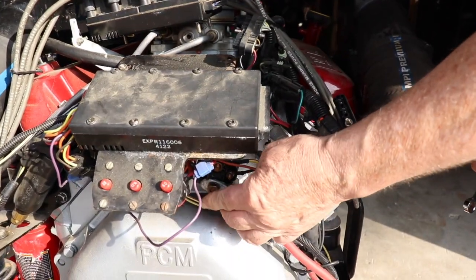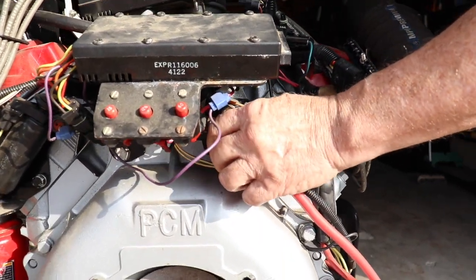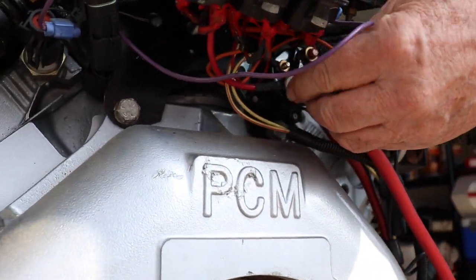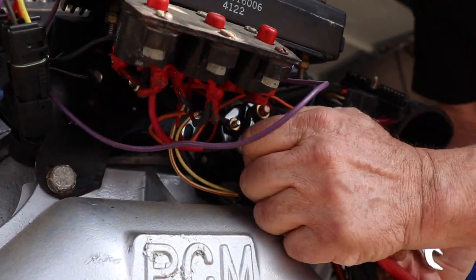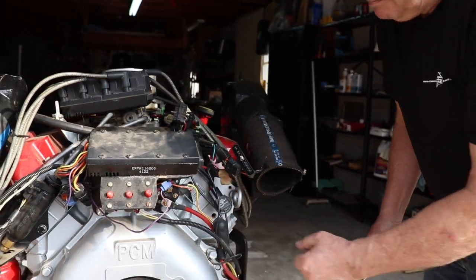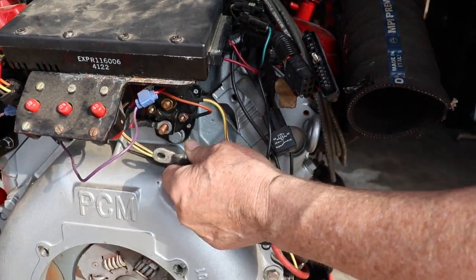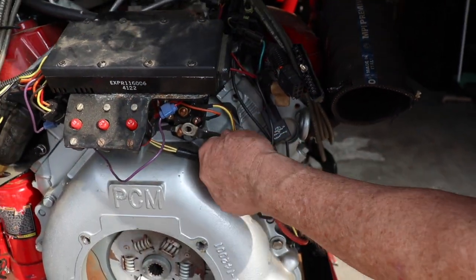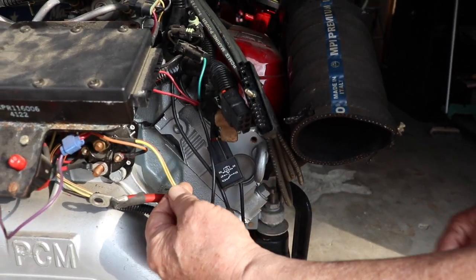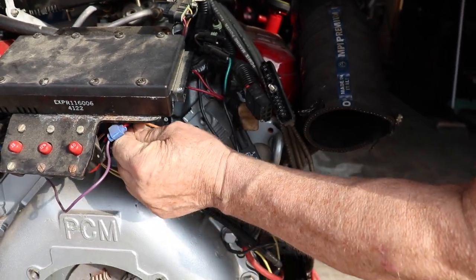This particular engine is a Pro-Tech engine, but this panel will be on a carbureted engine as well as a fuel-injected engine. It also uses a half-inch wrench. The reason I do this is just to get it out of the way. This is the cable that goes down to the starter, and the starter is also going to have to come off. So we're going to go ahead and disconnect that also. This is also the activating wire for the starter — I'm going to go ahead and remove it. It uses a half-inch wrench and comes off the starter relay.